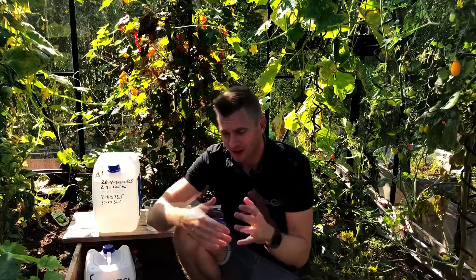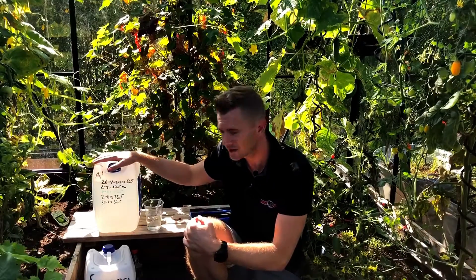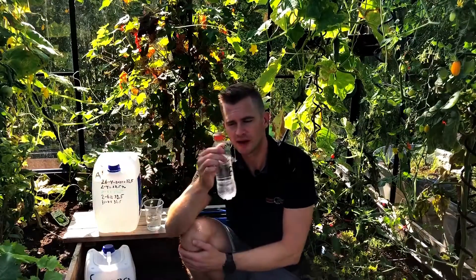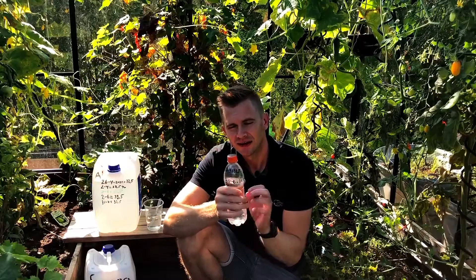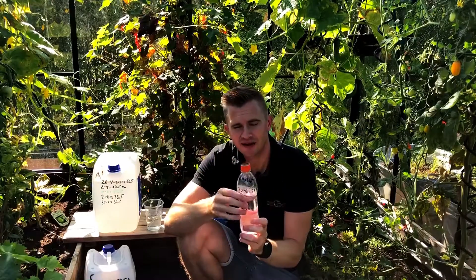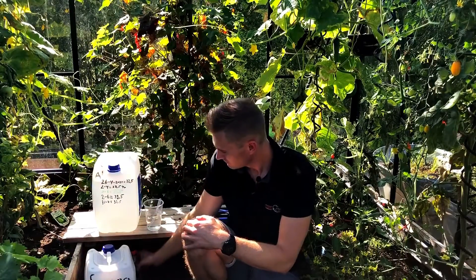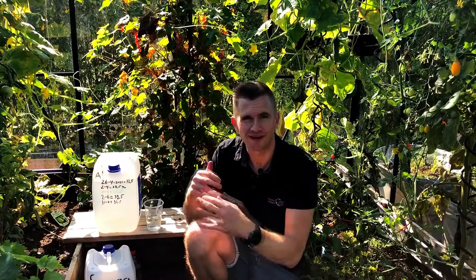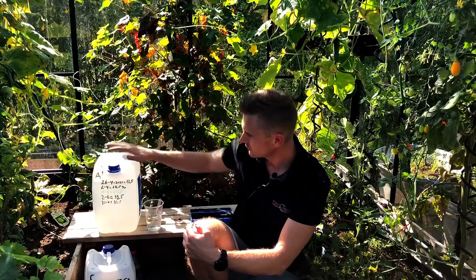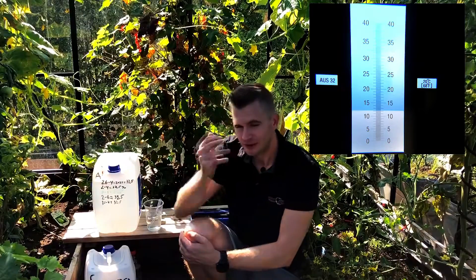So what did I learn from this experiment? To be honest, I suspected that the amount of urea would be a little bit lower on the one standing in direct sunlight, but it didn't — it had exactly 32.5%. I also suspected that the amount of urea would increase in the container with a hole in the lid, because the water would evaporate, but actually it had 32% of urea, so this would still be usable in the car. I was suspecting my meter, so I took a mixture of 50% water and 50% AdBlue Fluid and the meter was reading approximately 12% of urea — so the meter is working fine.